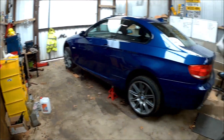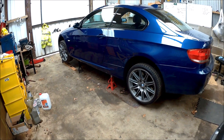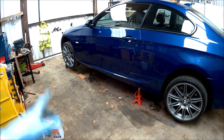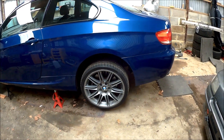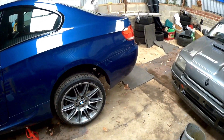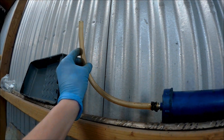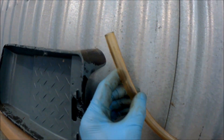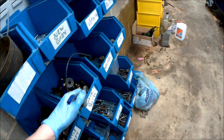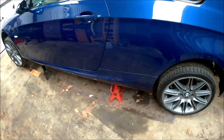Car's up in the air — level enough. I'm going to drain the front and then move the back up slightly more. I'll pull the diff filler out. Hoping that this little suction device will do it — it's worked on the four-by-fours but the hose won't fit in the diff hole. Might have some other tubing laying around, so we'll drain the front and drain the rear.